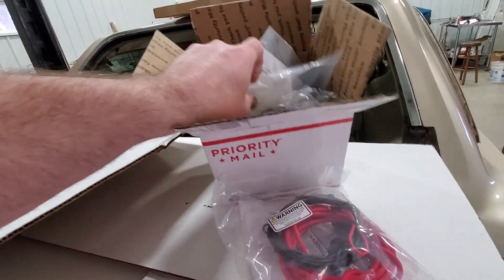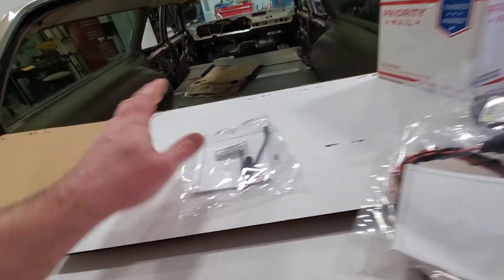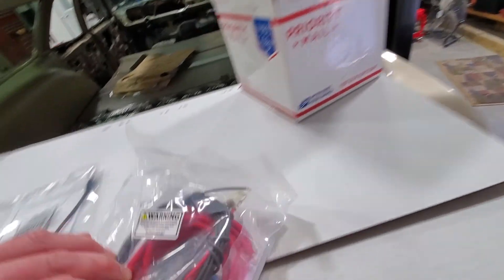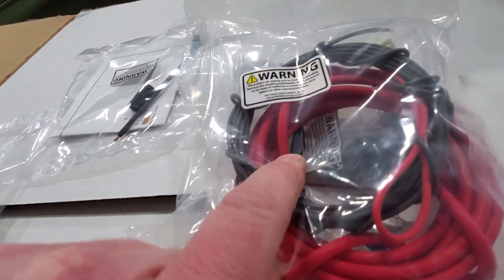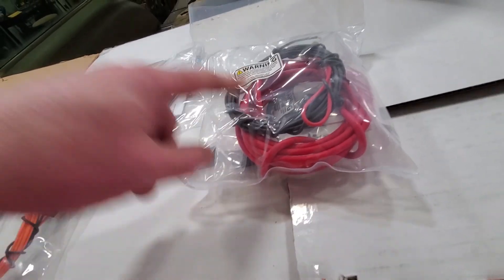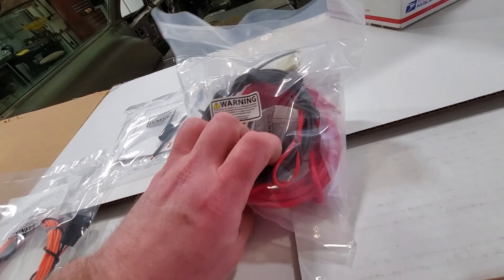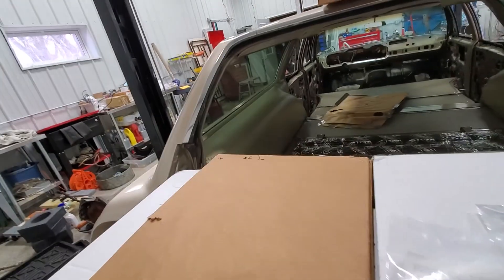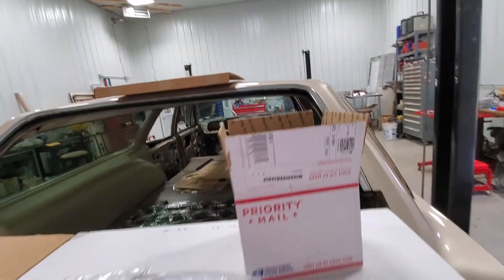This used to be part of their kits. I don't know why they've gone to those giant fuses — they're disgusting and I don't like them. So you get a nice fusible link to the cab, which will come off the stud on the alternator. There's a blue fusible link in here between the alternator and the starter stud, and then this large wire goes from the alternator down to the starter stud as well, with heavy gauge wire up to the battery. I prefer this approach on a car like this where we have no need for 175 amp service — the alternator couldn't feed that if it wanted to.